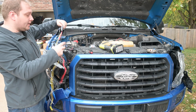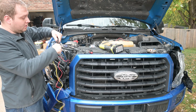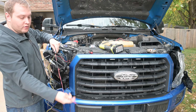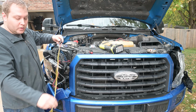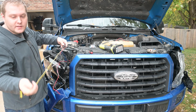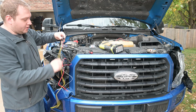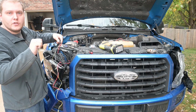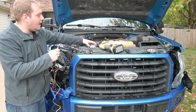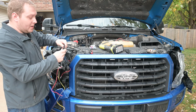It's included with the headlights. I'm going to install it. It's pretty straightforward. We've got a couple wires here that go to the battery, positive and negative. It's a fused link, so that's good. This yellow one can just get tied up somewhere. This is what they say it's for programming this at the factory, and you can just disregard it. And then the gray one is going to get tapped into the fuse box to an ignition power source. I'm going to add a fuse here, and we'll take a look at that in a minute.